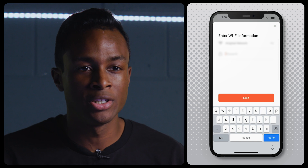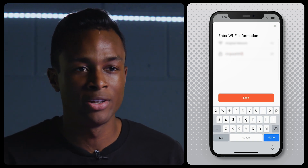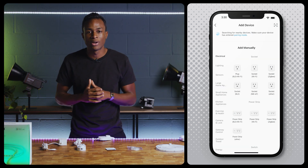Open the app, and from that point enter details to connect to Wi-Fi and allow access permissions with Tuya Smart for home data, notifications, and Bluetooth. After that, click the Add Device button or the Plus button on the top right.